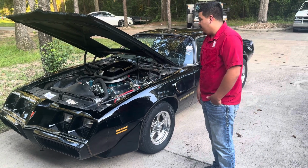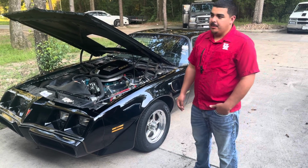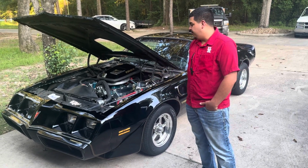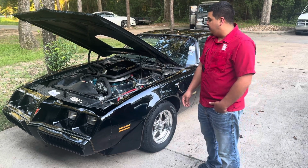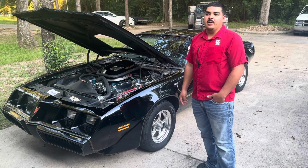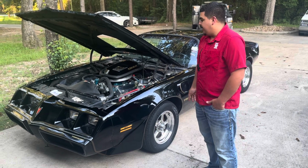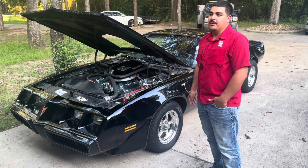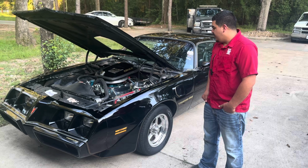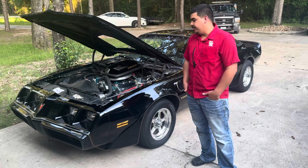I don't know. But in the meantime, I had ordered a bunch of parts for it, and the guy approached us about putting the 455 top end package on it, keeping the base of the 403 but with the top end of a 455. And we decided to do that. For the pistons, we went with Keith Black's 24 thousandths pop-up pistons, the race pistons. They give it compression, and those are hypereutectic pistons, but they're not just your cheap sealed power pistons. They're actually pretty good. They have that black coating on top of the piston in case you want to spray nitrous or whatever with it.